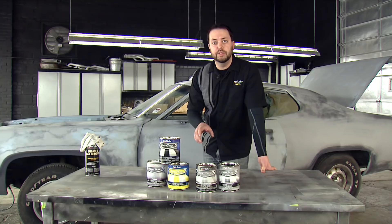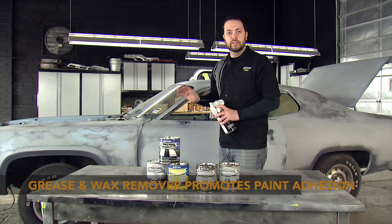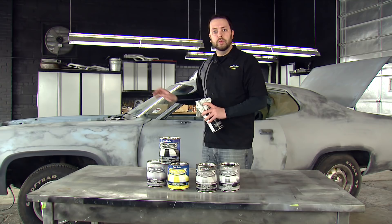To make it a little bit tough and fit this muscle car image, we're going to be using our Paint Shop metallic clear. We'll use our gloss clear coat afterwards. Before we get started with all that, I'm going to use our grease and wax remover to make sure there's no debris left after sanding, give it a nice wipe all the way over, and then come back with a tack cloth before we roll it into the spray booth.